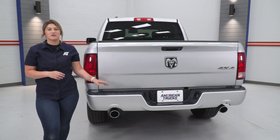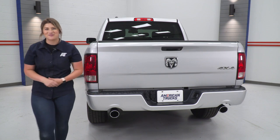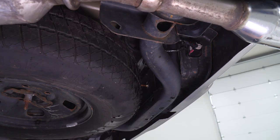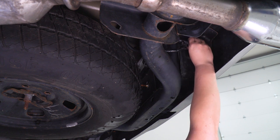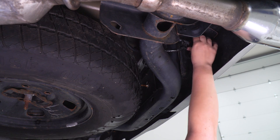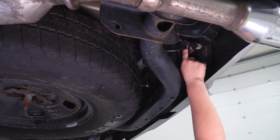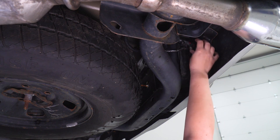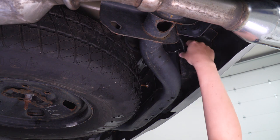To kick off this install, we're gonna start underneath our truck. I would recommend grabbing something comfortable to lay on and a 15-millimeter socket as well as a flathead screwdriver. Our first step underneath the truck is to start to disconnect our wiring harnesses. I'm gonna start with our license plate light on our driver side right here. I'm gonna pull that clip back — the reason why I said you may need a flathead screwdriver is for that clip if you can't get it back by hand — and we're just gonna pinch down on that and pull back.